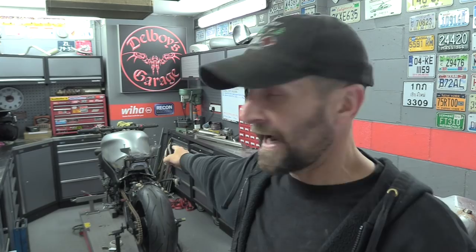Firstly, so I can get it off without having to disturb anything underneath. That structure is thick steel at the moment. It'll have all the electrics in it when it's done, as you know. Below that, underneath it, I want to put a steel under tray that hugs round it completely at the rear. And in between that steel under tray and that, it will have some heat proofing, because what I'm thinking of doing is maybe putting the exhaust up underneath that in the gap. The gap I've got between that and the tire is something like 14 inches at one point. That's a huge gap. I could easily get a slim exhaust in there, an oval exhaust.